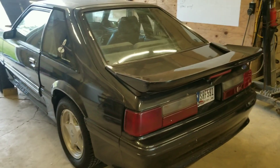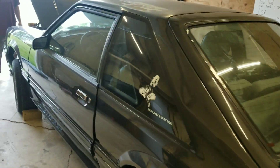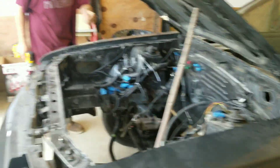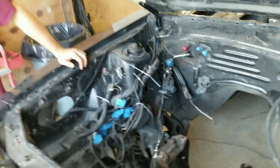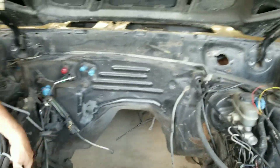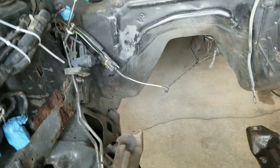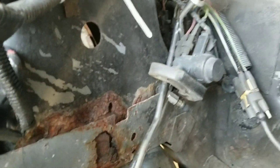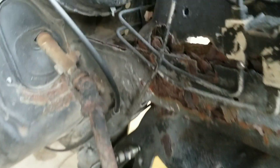Alright, we got a Fox Body — I believe it's an 89 or 90 — it has the common strut towers and frame rails. The rest of this car is pretty clean. I've been up underneath it, it's got one little spot on the driver's floor pan he wants fixed. You guys can take a look at these frame rails and the strut towers — he's wanting all new. He wants to save this car, and it can be done. That one looks real rough, I see daylight.